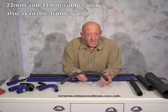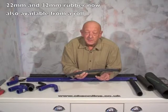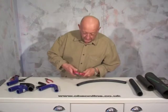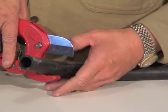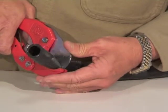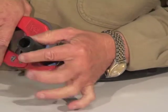So if you're plumbing, for instance, a heater, you can have a five-meter length if you wish. Whatever hose you choose, sooner or later you're going to have to cut it to length, and the easiest and neatest way is using our hose cutters. I'm going to cut this piece of 19mm heater hose. Pull the handles apart to open the blade, close the blade down by hand on the hose — keep it nice and square — and pressing the blades together, ratchet the blade until it makes a nice clean square cut.